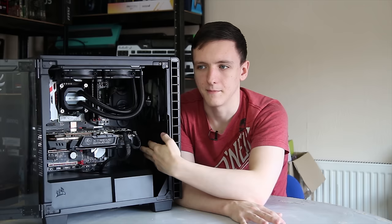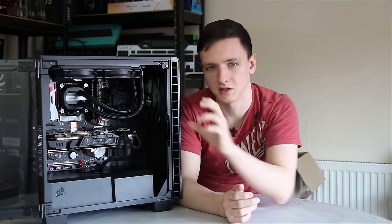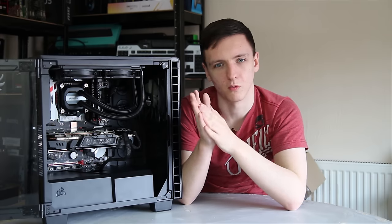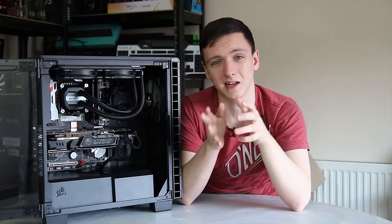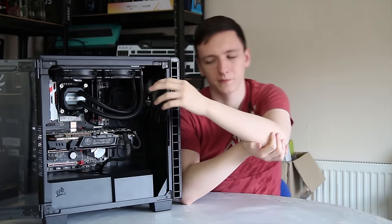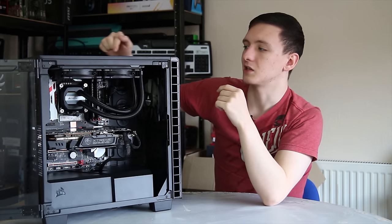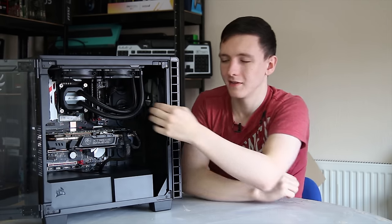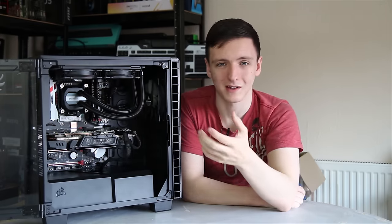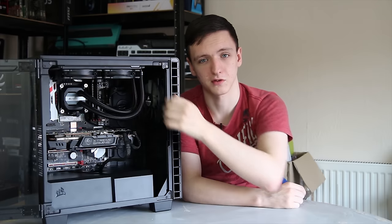Because this is an ATX chassis that only fits ATX motherboards, there's quite a lot of room between the grommets for the power supply cables and the motherboard. I don't know whether this is just to make the cable bends easier, but it definitely does well, though you will see a lot of cable. So if you're planning on going with some extensions, this might be quite nice. Also, when installing a closed-loop water cooler at the top — for example this Corsair H100i V2 — you might actually be hitting your RAM, especially if you have high-profile sticks.